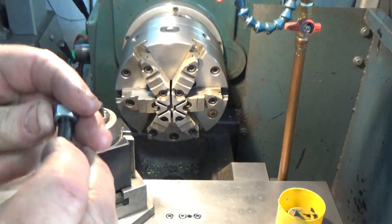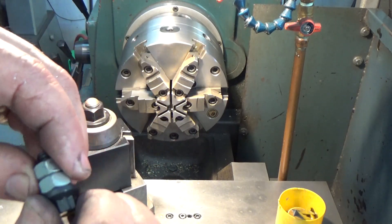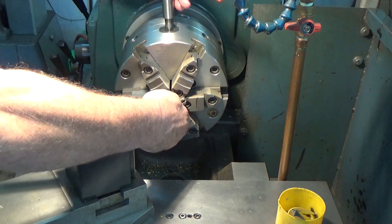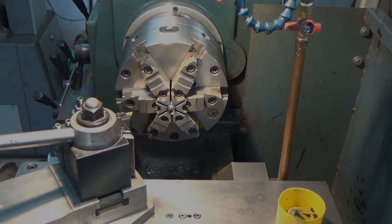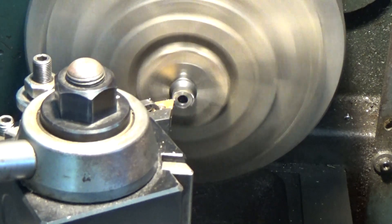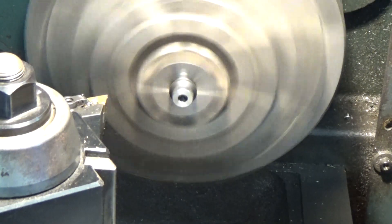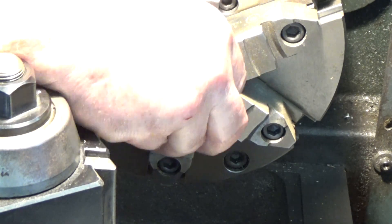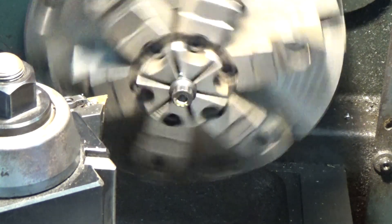What I found with the cover is that those bolt heads were a little bit tall, so I'm going to machine the top off a little bit. To keep from marring up the threads, I just screw a couple of nuts on there and stick it in my lathe and machine it off that way. Even machining those bolts, the way the steel comes off you can just tell it's quality steel. I really like the ARP product.